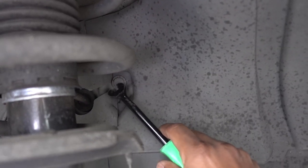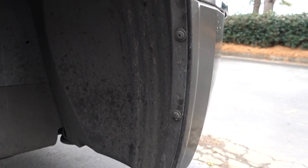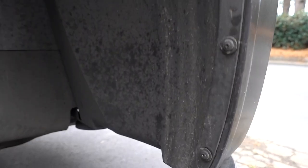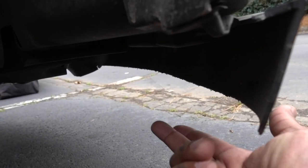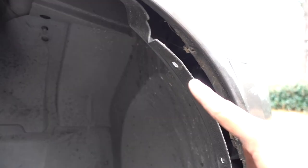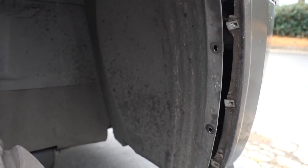This one right here under the strut — I have to remove that one too. Also you have four screws in here; remove those four. Two more on the bottom and one clip on that side. There's one screw in there, another screw in there, and another clip over there. Hopefully you can see it. I was missing another screw in here, so a total of five here. Two underneath, one clip on that side.